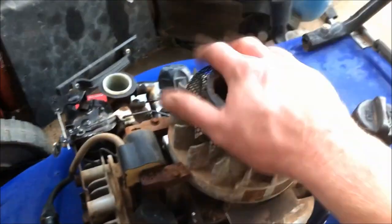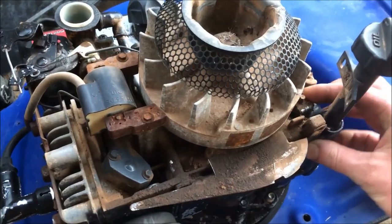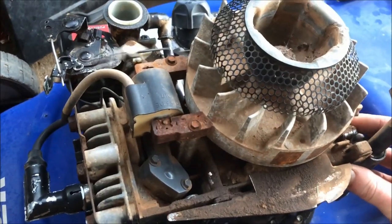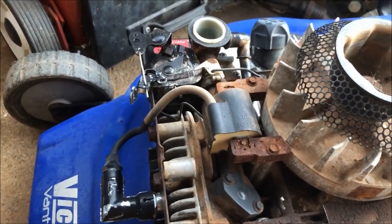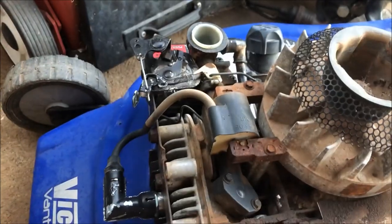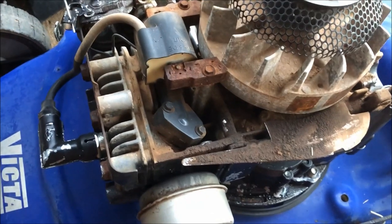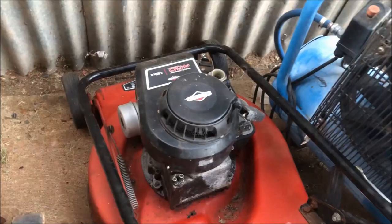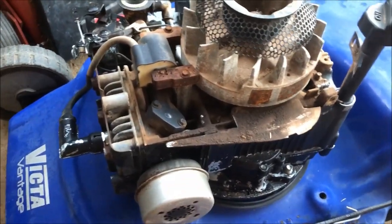We'll get this top cover on after blowing it out, rebuild the fuel tank, and then I've just got to find a top beauty cover if I've got one - if not, no big loss. This must be a 500 series, 10 cubic inch with an internal governor. It's got the slightly smaller governor spring that hooks directly onto the carb. Otherwise it's pretty much the same as say a Sprint 375 or 450 series, they're only 9 cubic inch. Anyhow, moving on.